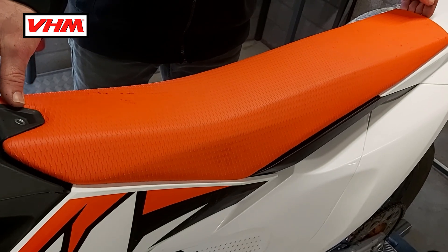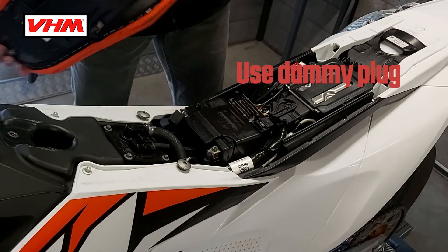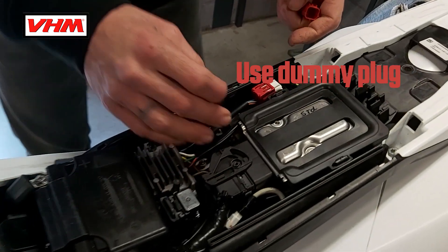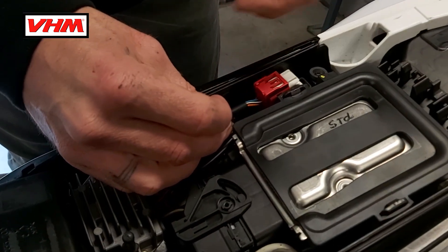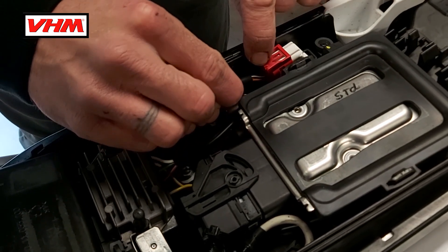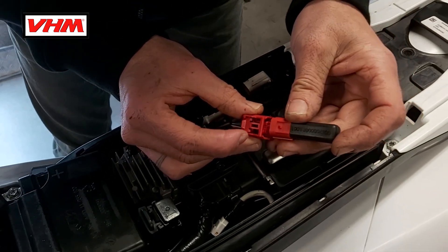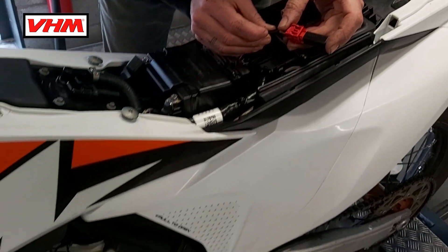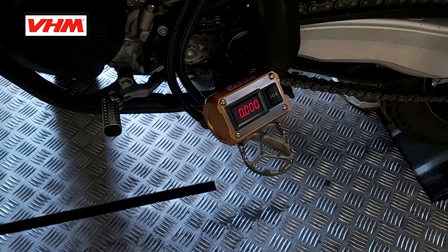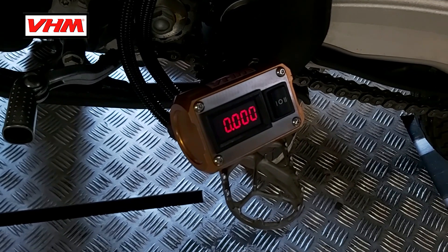With the seat taken off, you will notice on the right side of the ECU the red diagnostic connector. We're going to put the dummy stick in to get the ECU out of sleeping mode. This is the red connector on the right side of the ECU. Take it off with a small clip. When you put the dummy stick in, you will notice on our tool that the ECU is coming out of sleeping mode — you will now see the voltage on our display. That means it's working.